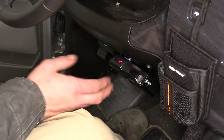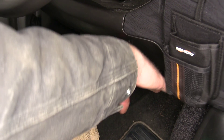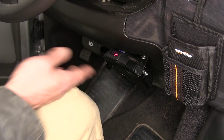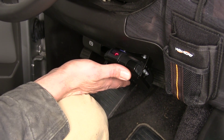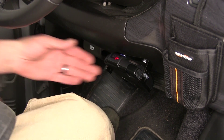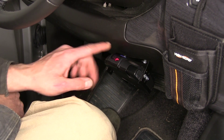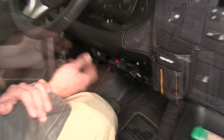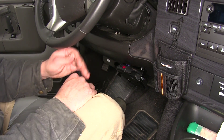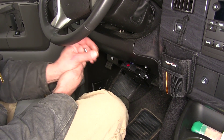The Primus IQ is fully proportional, so we're able to mount this from 0 degrees or flat level up to 70 degrees, as long as we keep it on the vertical plane, meaning that it's in line with the direction of travel. The accelerometer inside is going to sense when we put our foot on our brakes to slow down the vehicle. Once it senses that, it immediately starts putting braking power to the rear however we've got it set up. This is a big advantage over time-delayed brake controllers because we don't have to wait for them to engage — those slowly build up over a designated period of time, where this one gives us that immediate response.